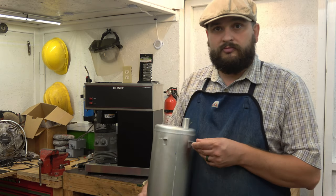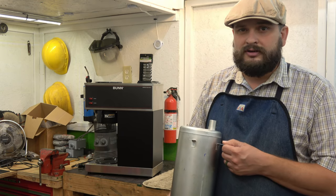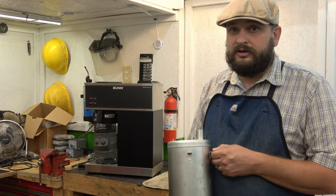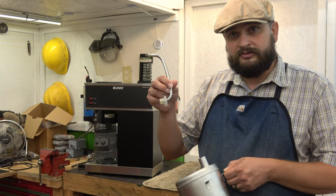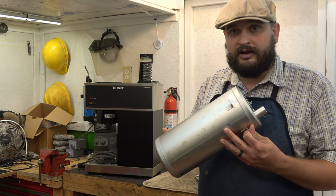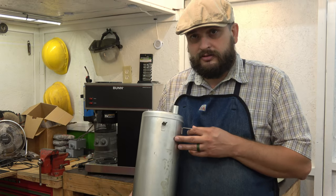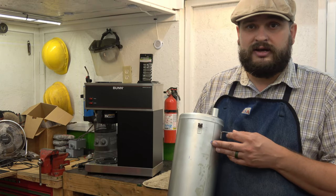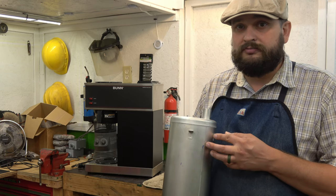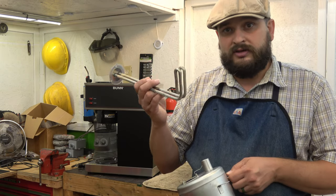So what I think is happening — because I've gotten a few emails every now and then where people say they have no water when they go to make their coffee, put water in, nothing comes out — well, I've been telling them for years to clean the tube out, not thinking that this tank might not be full. So this one right here, it's pretty obvious what happened. COVID comes along, the church shuts down, they're not able to have services for several months. It looks like the coffee maker was left plugged in, and when it's plugged in, the heating element runs on a thermostat and stays on all the time.